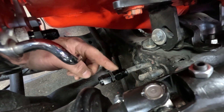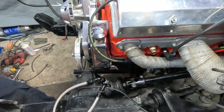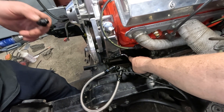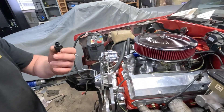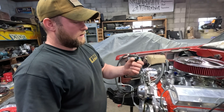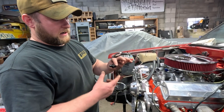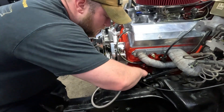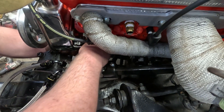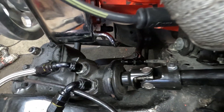Your stock fuel line is 6 AN. And what are those? Those are compression fittings that go to AN. We do need one for that, and we'll need one of these too. For the fuel line ones, they always have female ends — I'm not sure why. They don't come with a male end; maybe so they swivel. So you need a male-to-male adapter — this is a 6 AN male-to-male. Good to go.